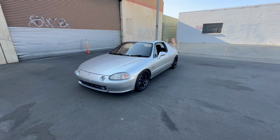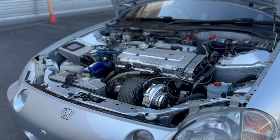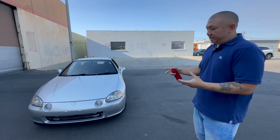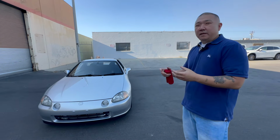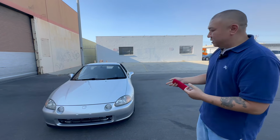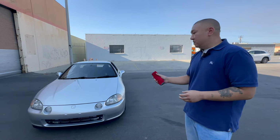So it's boosted. I know the viewers probably want to know what's under the hood. Under the hood is an LS-Vtec turbo, 84 millimeter with RS Machine sleeves. It has CP 9-to-1 pistons, but we put Ferrea 6000 valves in there, so it's about 9.2-to-1 compression. Manley Turbo Tuff rods with 625 hardware, King bearings. JE Pro Seal head gasket with the B16 head with Ferrea valvetrain. 6000 valves, Ferrea keepers, the whole nine. And then it's rocking C5 ITR camshafts, Golden Eagle cam gears.